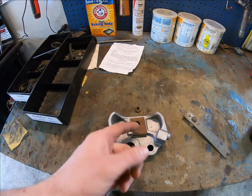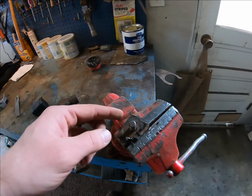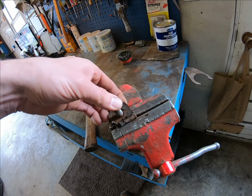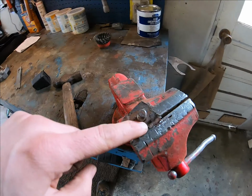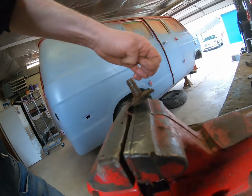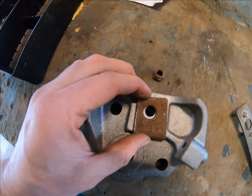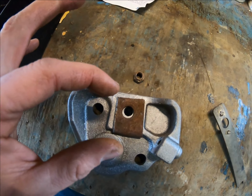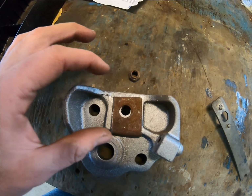So this leads me to just cleaning it up, and then what I want to do is get this stud removed. It's probably like an electric welded or kind of mig welded on there. So I'm just kind of beveling away with the cutting wheel this piece to where I have just the stud, and you can see there's the head of it, and then I will poke it through here, and you'll see I might have to either elongate that hole or position it to where it sits in this upper section, so to speak.